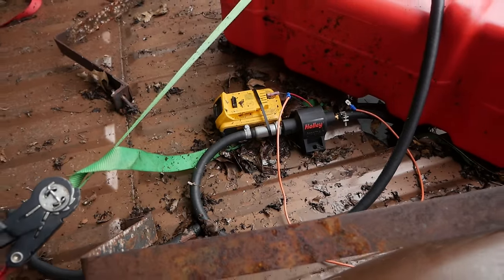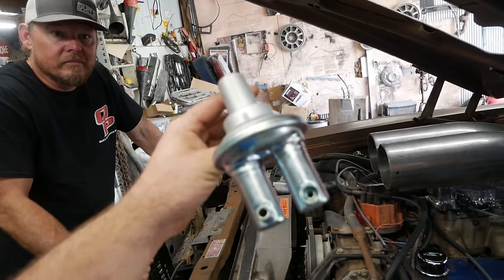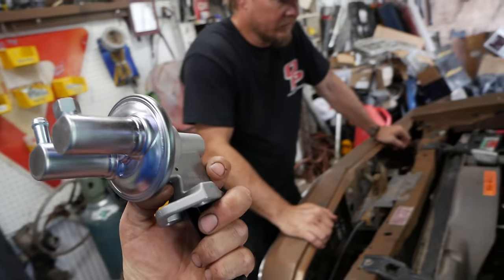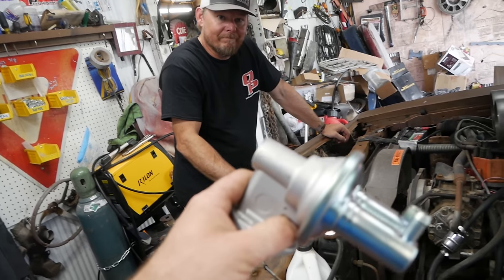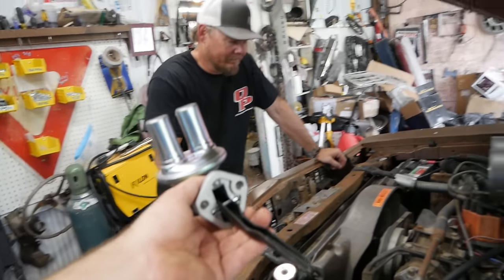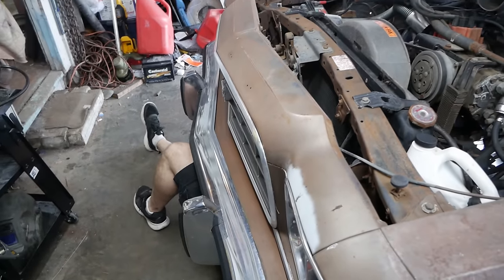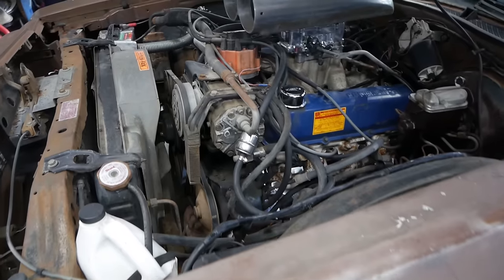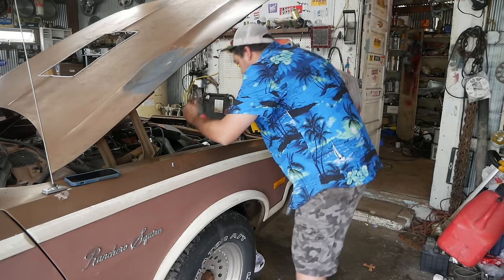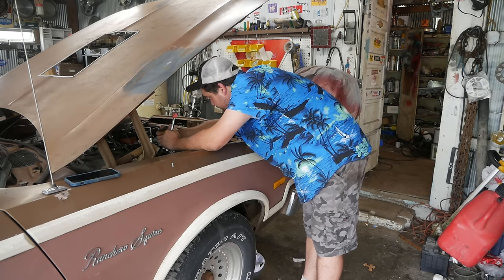I bought a generic O'Reilly fuel pump — 3/8ths in and 5/16ths out, which won't feed this engine well. Question answered — I have this in my hand. These are absolutely no fun to get to. I've conscripted Buff to change the fuel pump while I pull plugs and see what they look like. I'm not expecting anything too wild, but you never know — might be a cracked porcelain. The engine is still very hot, like they just drove it. Number one plug is pretty black — rich, but no oil, which is good. That could be from the old carburetor or the plugged air filter.